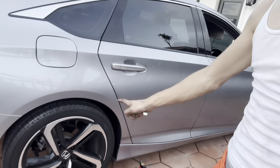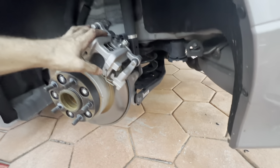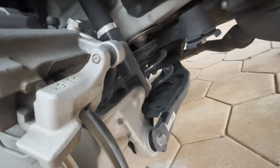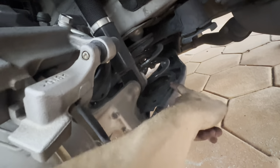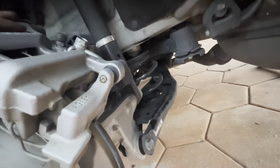So I'm going to get this apart first. I'm going to get this wheel off. And the back should be way smoother than the front. Because it just has the bucket and then you just put the spring in. So let's do that real quick. So this is the back. All I have to do is just remove this and then the bucket should drop down enough. It has some slack to it, so it should just let me slip in the other spring. And then I'm going to zip tie it down. Because since the spring is shorter, I'm going to zip tie it down so it doesn't fall out.